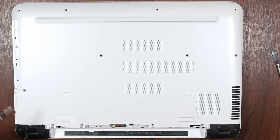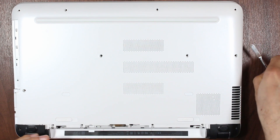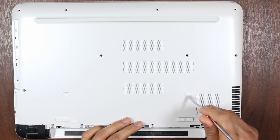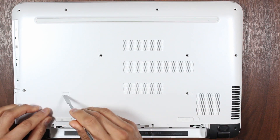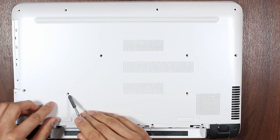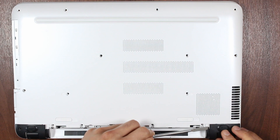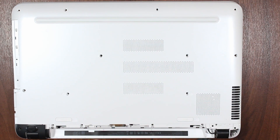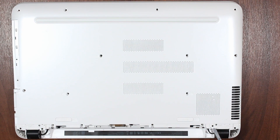You also have two tiny, quite flat screws here. Then there are about four hidden screws. Two of them are going to be under this little plastic tab — one here and one here. The last ones on this model are going to be under this cap here next to the hinge. You might want to use a pry tool to pop it off — it kind of clips off. There's a screw here and another one here to remove.